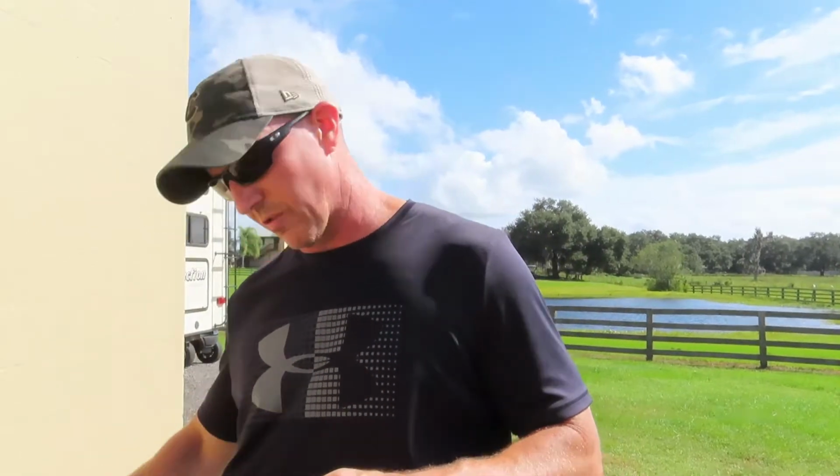You can find some pretty good deals on AGM batteries, and if you never want to have to hassle with worrying about checking the water, if you want something you can install and know that you're going to be good to go for probably 4 years at least, then AGM is definitely the way you want to go. AGM batteries are also going to prevent a lot of corrosion. With wet batteries, anytime they charge, they do gas a little bit, so you get some corrosive gases that come out of them, and that's going to cause corrosion on your terminals if you don't keep up with it. You've got to make sure to keep the terminals clean. AGMs kind of eliminate a lot of that issue. So a lot of benefits with AGM batteries.